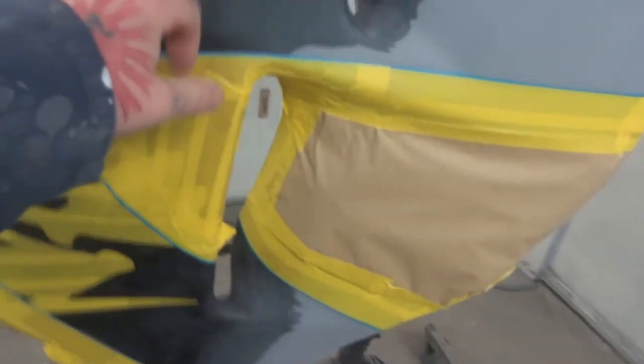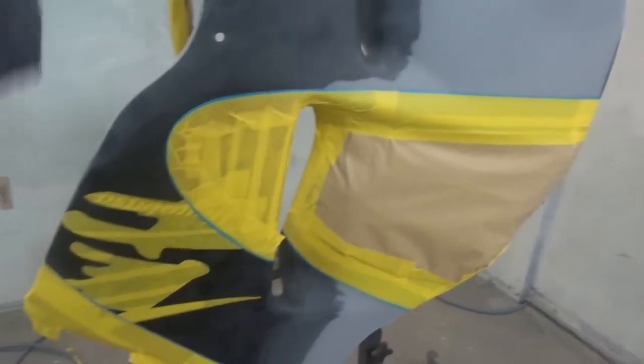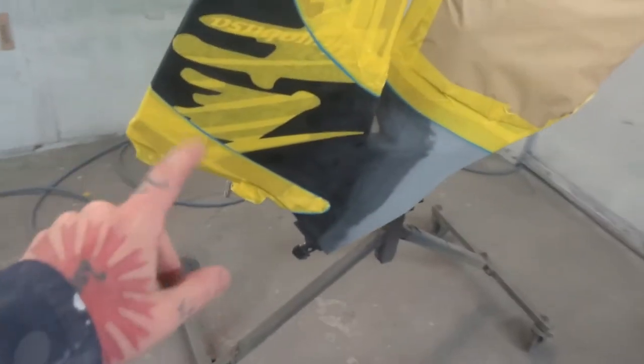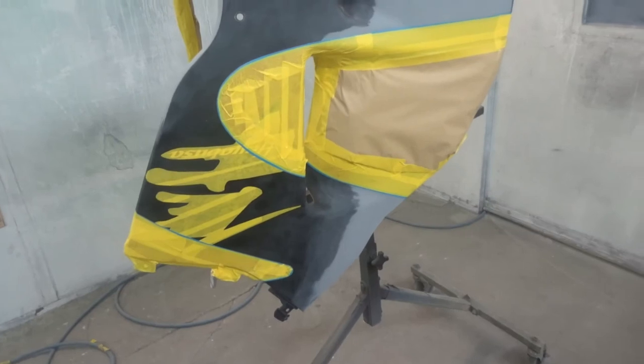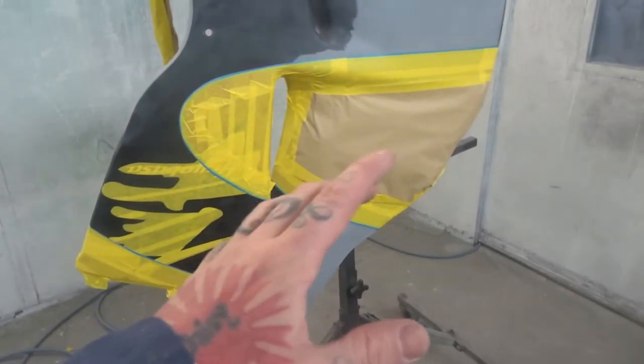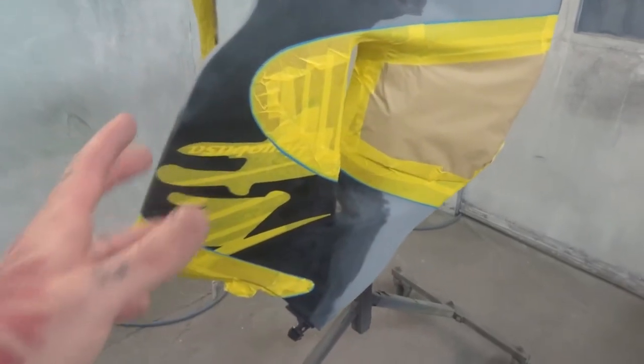I've got boosted panels. He thought this was a sticker, but it's not — it's paint. It's all prepped, all the primers are prepped, scotched it. Masked off the right end. I'm going to do the black base coat, unmask it, lacquer it all, then scotch it — thousand it — do the red, and then lacquer it again. That's what we're doing.